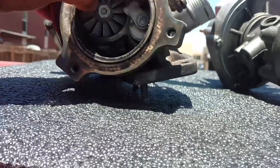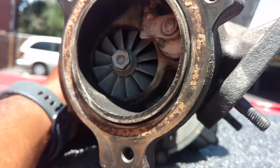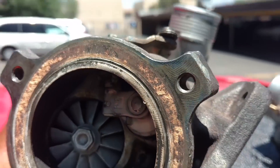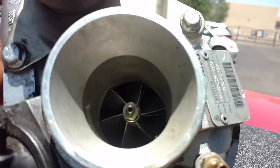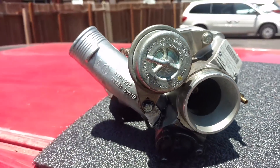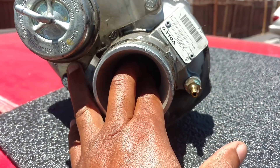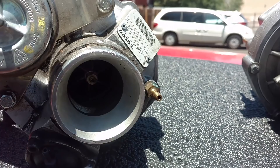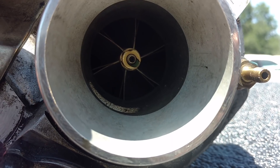The turbo on the left is out of a T5 vehicle. As you can see on the exhaust side, the turbine is a good grayish color — it's not dark. The compressor wheel down in there is the standard compressor wheel. This turbo is about 12 to 15 years old, so it's got some wear on it. When I check it for shaft play, I have no in-and-out play, and at first I could feel no side-to-side play. After doing it a few times, putting one finger on the back side and the other on the front side, I could feel just a little bit of play.